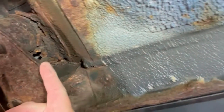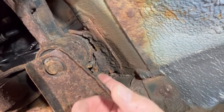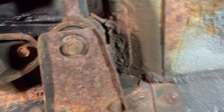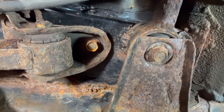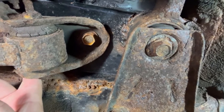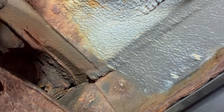You can see the t-bar is right here where it mounts, right across there, and you can see it's completely rotted out there — about ready to fall through. So that's completely shot. Then walking back towards the rear of the car, you can see where the trailing arm comes up and mounts here. There's been a patch panel welded here already, so I'm going to tie my patch into this current patch panel and do a bit more welding, and also tie in up here where there's some good material.